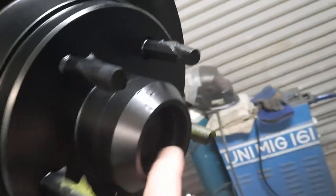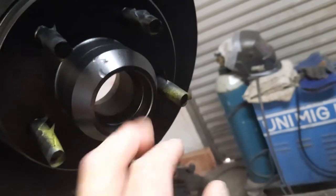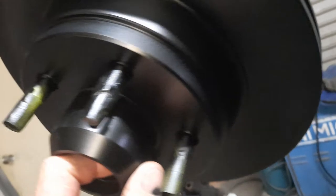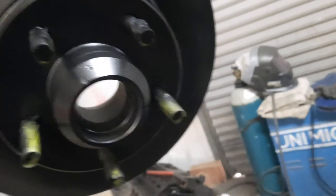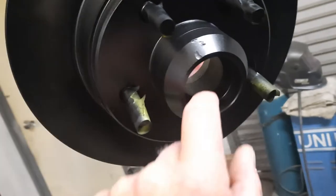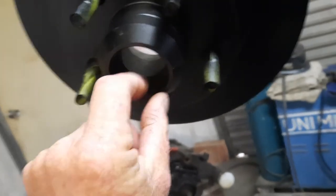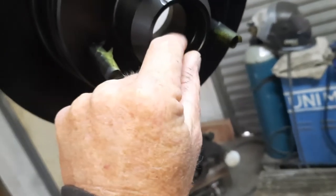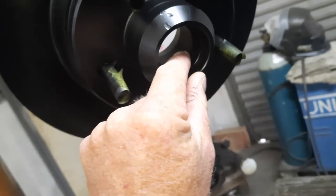I haven't masked up in here because there are already cups in here. That makes me feel like I've been a bit ripped off, actually — if there are already cups in here, these rotors most likely would have come with new bearings, and I've had to buy bearings separately. As I said, I haven't masked them because I'll be taking them out. You don't ever mix your bearing cups — even though these are brand new, they might be a slightly different angle to the new bearing.